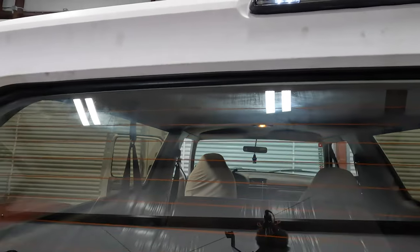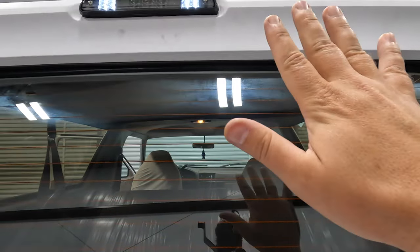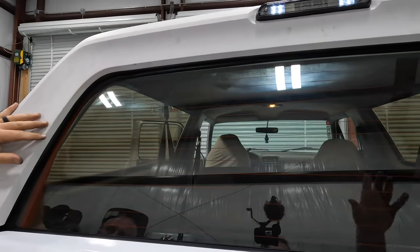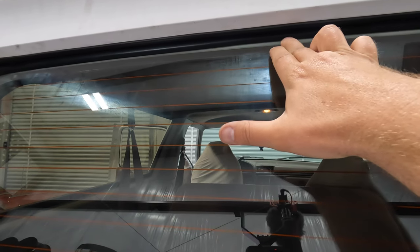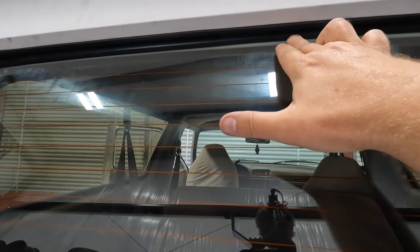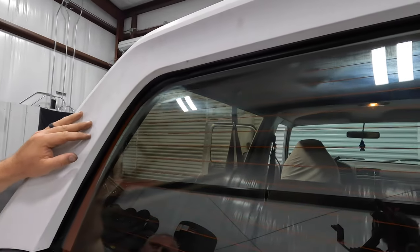We're going to leave this glass up, put it out in the sun, and let everything kind of set in there. The glass wants to hit on the inside of this rubber first and then get conformed so it will slide up into the actual track. I think we got the glass in and the seals in. If you want to see more videos of everything we've done and are doing to this Bronco, we'll put that playlist right here over Sam's face — you might want to go back and watch from the very beginning. We'll catch you in the next one, peace.